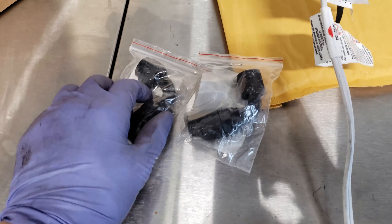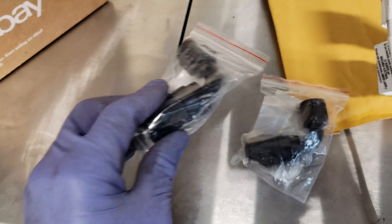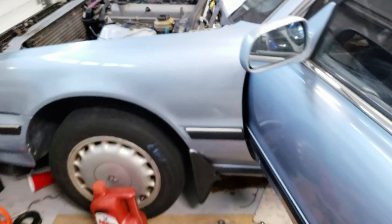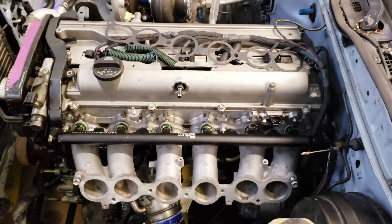In this one I got two new 90-degree dash-8 fittings that I'm going to use to remake the hose going to the fuel rail from the fuel filter. So this is actually where the motor is going to sit — this is final position, lock down.